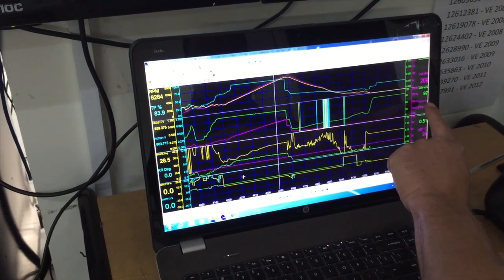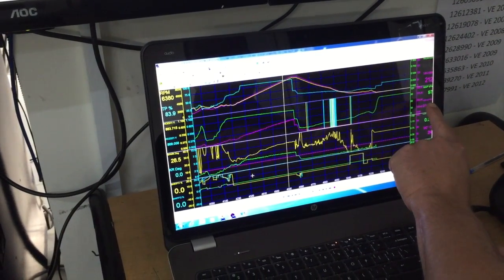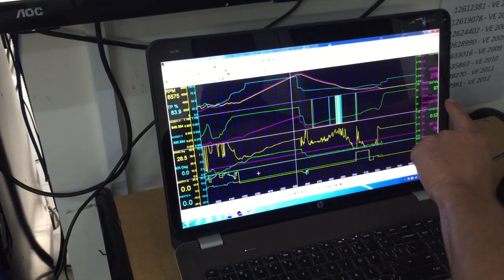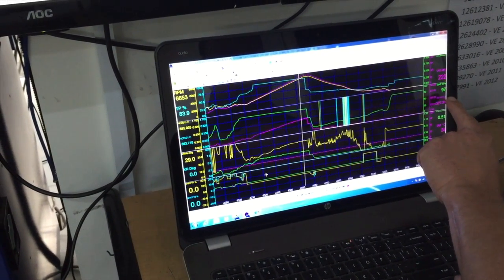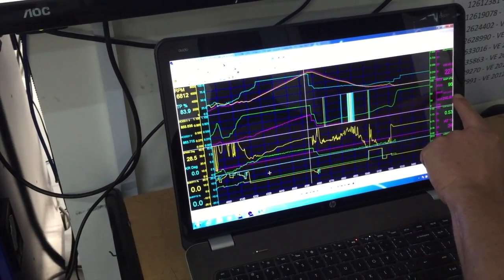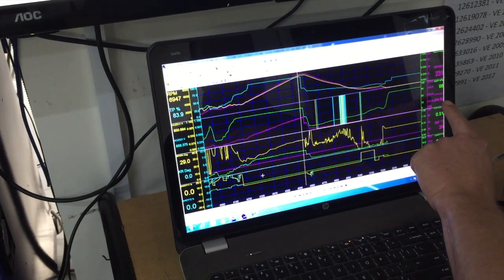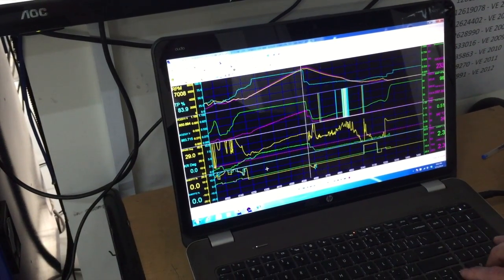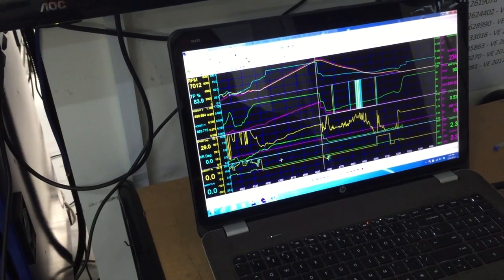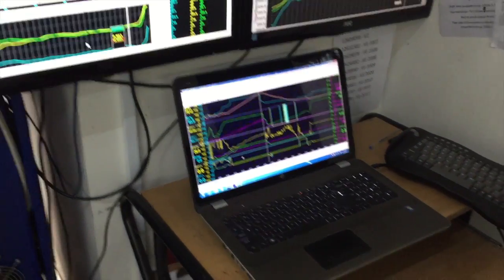With a well designed air intake you probably can get a little bit more air through the throttle body even though it is a certain size. So in this particular case, once we're getting up in our RPM level, you can see this coming down to 96. And basically what that does is allow the engine to not produce as much power as it could. So we're even down to 95 kPa at 7000 RPM. So that's producing basically an air restriction, and if we could fix that even further we might have some more power on the table.